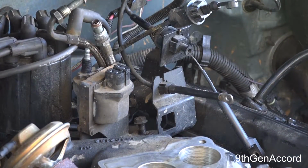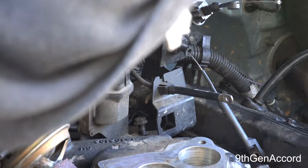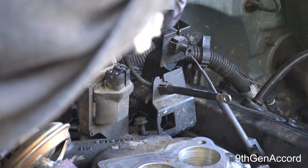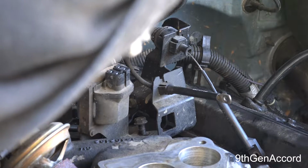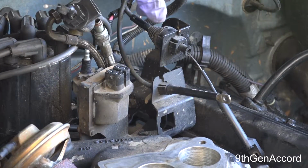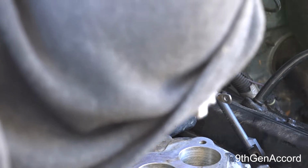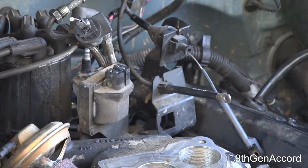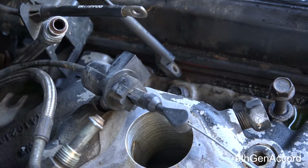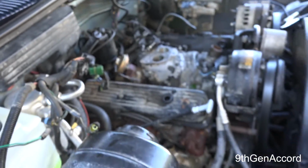Alright, so I popped the cable out here by depressing the two tabs on the top and the bottom. I just set it aside, and the reason I had to do that is to get this bolt out. And I guess there's another one, I can't see it, but this is one that holds the coil assembly on. There's another bolt right there. But anyway, that's how the coil comes out. And now we're really starting to get some room in here, and we'll be back.